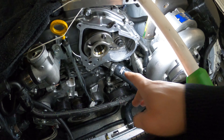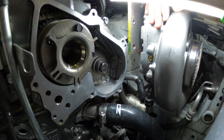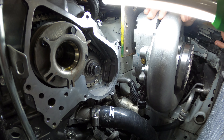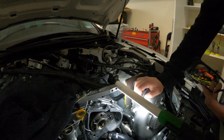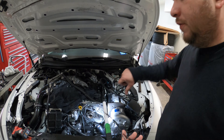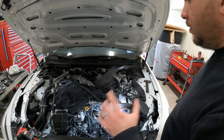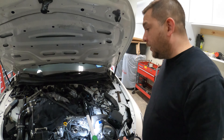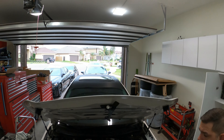I will tell you this — it was extremely difficult to get that out after you put the loctite in and seat the threads. It was damn near impossible to pull out. We had to use a torch and heat up the aluminum all the way around it to expand it — took 30 minutes to get it out. That makes me feel confident these aren't gonna pull out easy; they definitely don't back out if you go to reverse your bolt, which is great. Let's get the kid dressed and ready and take the new-to-me SUV and drive to Harlingen.